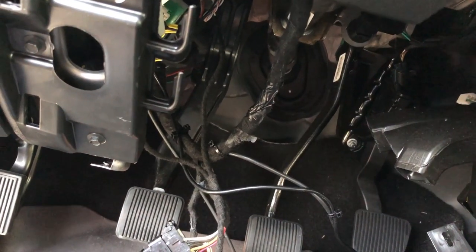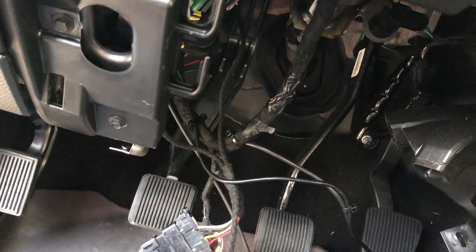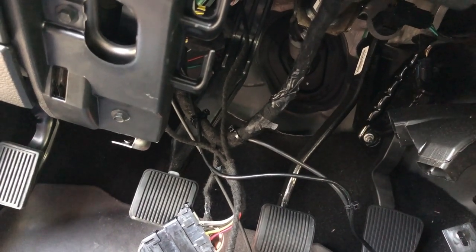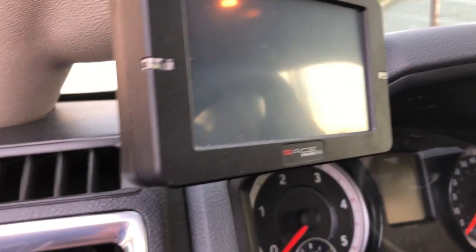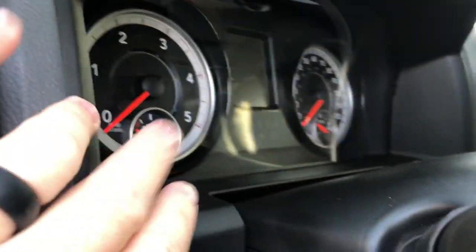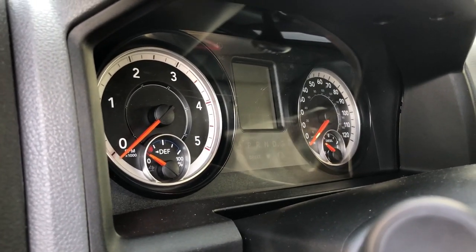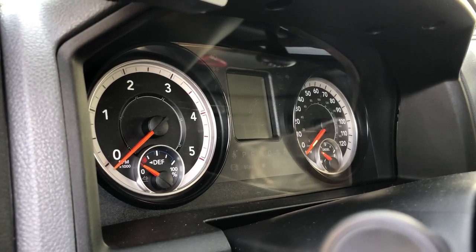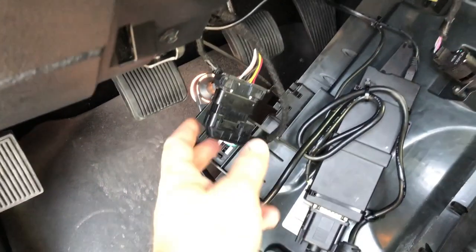There have been a couple of instances of programming failure due to the CAN bus communication being blocked through the security gateway module — utilizing programmers such as the Race Me, Race Me Ultra, and the MM3. If this occurs, the dash lights will not shut off, and it'll drain your batteries because it doesn't complete the programming process. Even if you pull the battery cables, it will not complete the process.